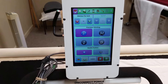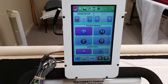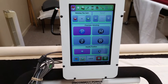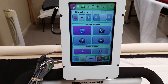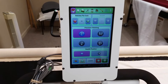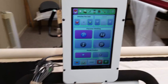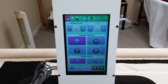Your home screen will come up. If there's a communication error with the back of the NV, note that there's a considerable amount of electronics back there — that's where the bulk of the stitch regulator components are. The tablet at the front is basically just the dials, buttons, and switches to control and signal to the stitch regulator; it doesn't actually control the stitch regulator itself.